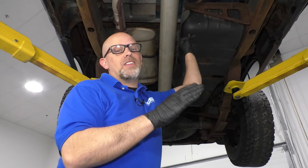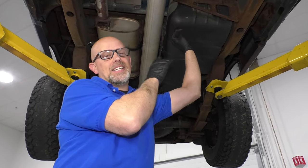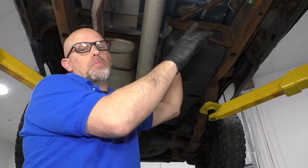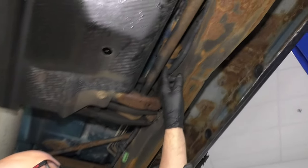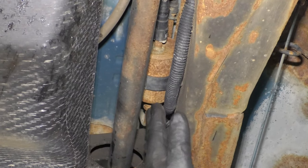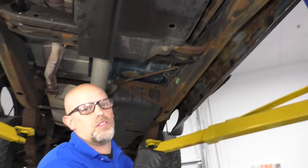Some of the things you can do to prolong the life of your fuel pump: keep more than a quarter of a tank of gas in the fuel tank — that's going to keep the fuel pump cool. Also, replace your fuel filter, which is located right here. You want to replace that about every 30,000 miles or less to keep good flow of fuel and don't put too much strain on the fuel pump.